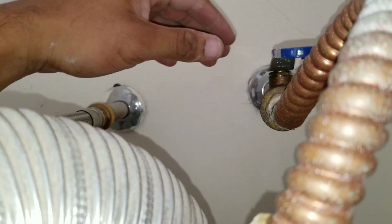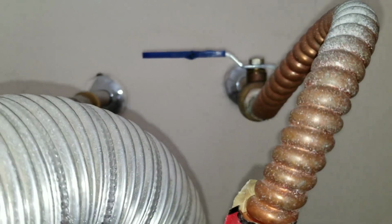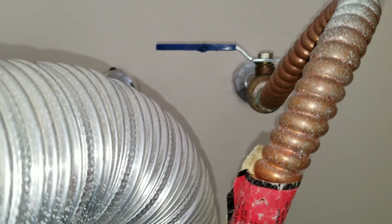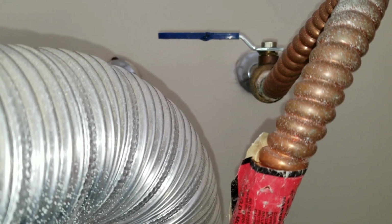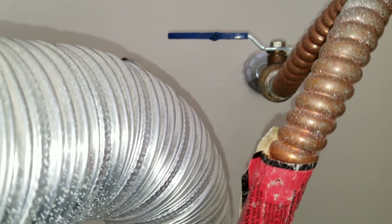You would find your water heater or your shutoff for your hot water coming in, and you would turn that to the off position. And once you do that, that will allow you to remove your supply line and remove and replace the angle stop. Remember, your dishwasher is supposed to be connected to your hot water for it to clean effectively.